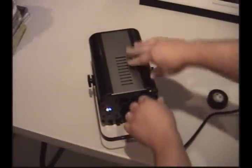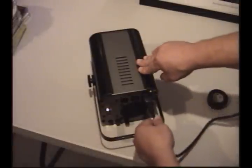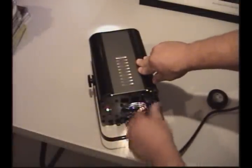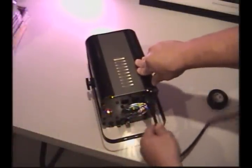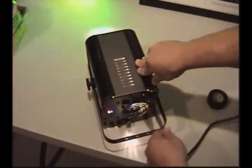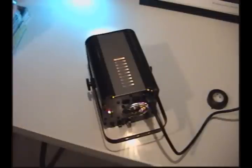As you can tell, the first time I plugged it in it definitely took a little bit of effort — I probably could have taken a little bit of that tape off — but we got it to go in. What I like about this now is, even though it was a little effort to get that plug in, it's nice and firm. You can still remove it at the end of the day, but the unit's not turning off anymore and there's no wiggle room. Just a quick fix: if you have lighting with that type of plug and it's not staying plugged in, a quick wrap of electrical tape will firm up that socket. Hope that helps — practice and enjoy!